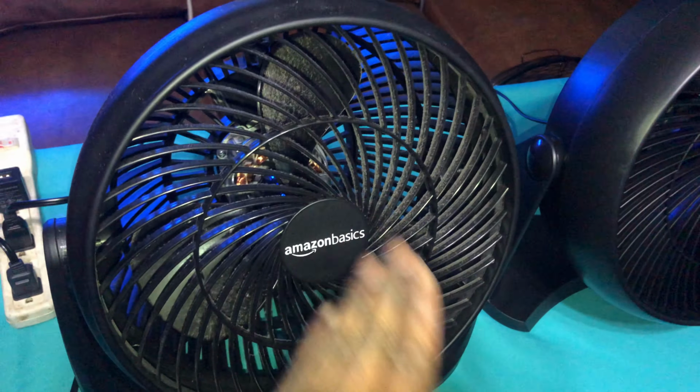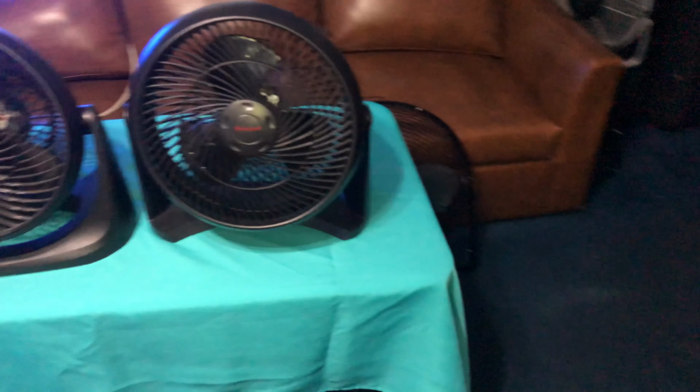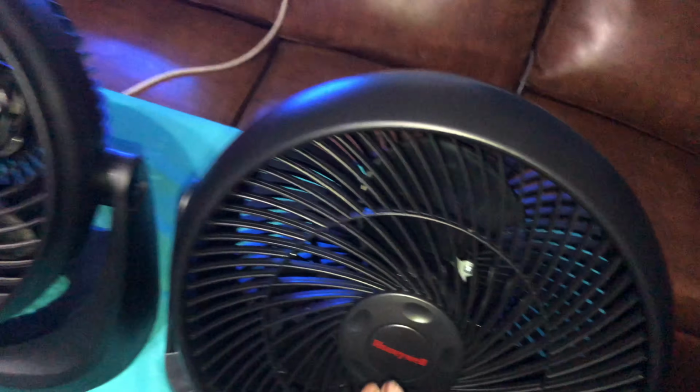And of course, you can see the PSC motor on this one. That's a much bigger PSC motor. And then the blade size on this one is about maybe 9 or 10 or even 8. So they definitely cheated you out of the blade size on this one. But they did give you the 11-inch guard, as opposed to this one over here, which is slightly bigger. It's probably a 12-inch or possibly 11 and a half, so that we could fit the even 11-inch blade. Very steep, very deep pitch. And of course on this one, it's deep pitch, but it's just not as good as that one.